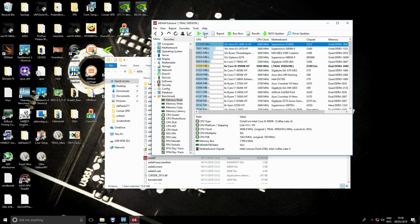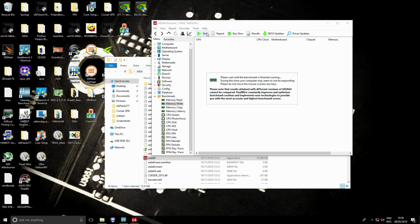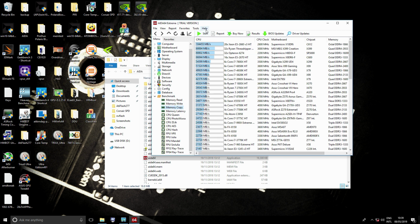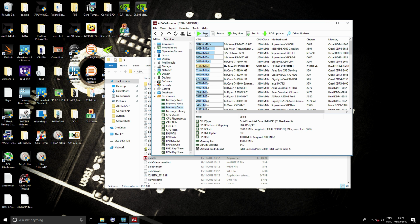Okay, so we're doing 53.5 gigs. So we picked up like another 1.5 gigs over the previous 52-ish, or like a gig. So we didn't really pick up a whole lot of speed there. Write is 56 gigs. That's not bad at all. We're kind of hitting the limits of what you can do at this kind of memory frequency. We're only at 3600. If we were at a higher memory clock, then we could probably push 60 gigs, but I think you need at least like 3866 for that. So that's not gonna happen. And we are on 52 gigs for copy, so that's really not bad either.